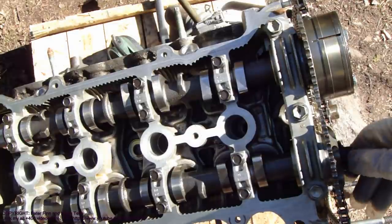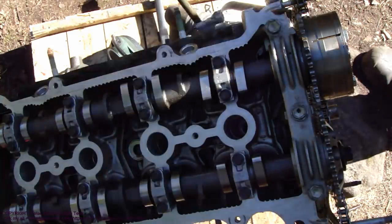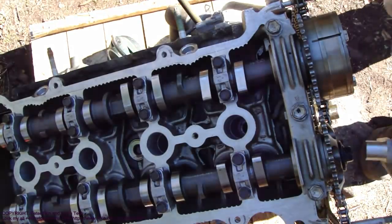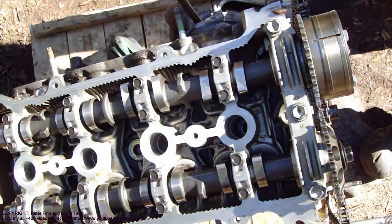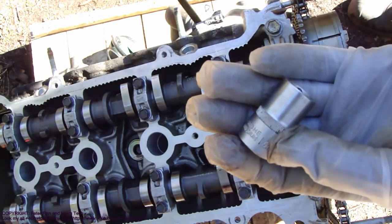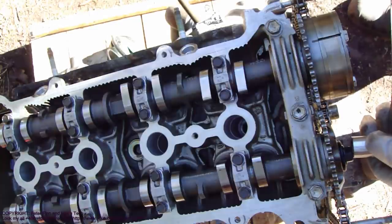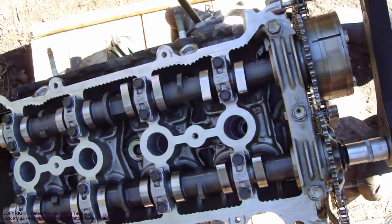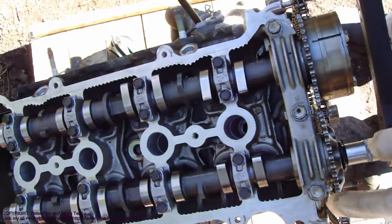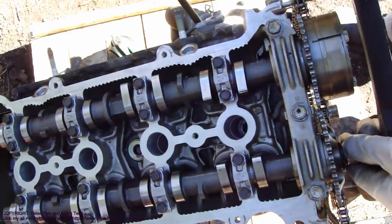And if there is a situation that in some cars these cams are now down, then we need to insert in here one socket, and we need to rotate. There is this 14 millimeter socket that fits in these parts, and then these parts in here we can rotate clockwise, which means in this direction, in that way and here.